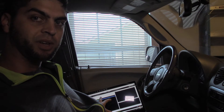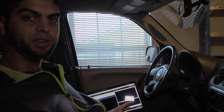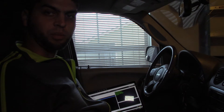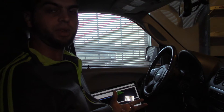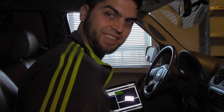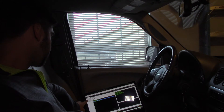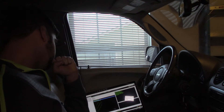So fingers crossed, we're going to see if we can reflash this computer. First I'm going to try to identify what ECU I have — there are a couple of different serial numbers out there. Step one is to identify your current ECU. Good news: we're plugged in, we've got proper voltage readings. They say you want to be over 12 volts — I'm at about 12.1 with the key on, was at 12.5 before. On the left-hand side of the screen there are three options: ECU ID, Read (F2), and Write. We select Read.